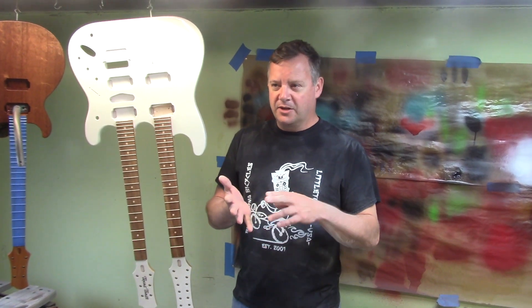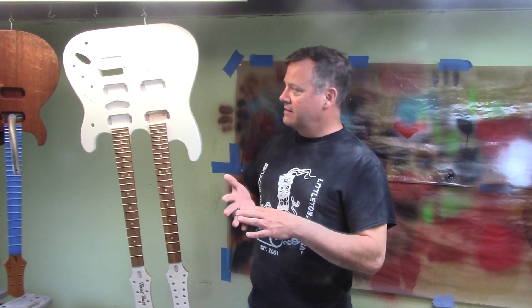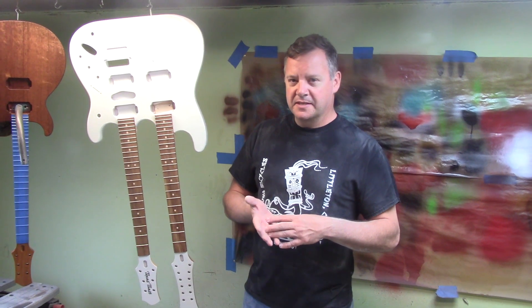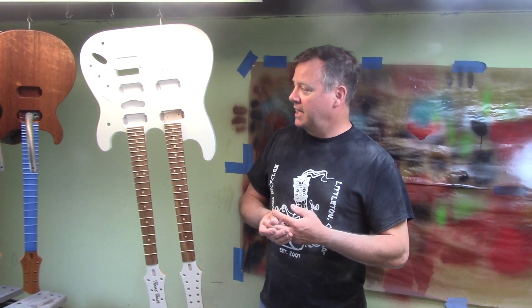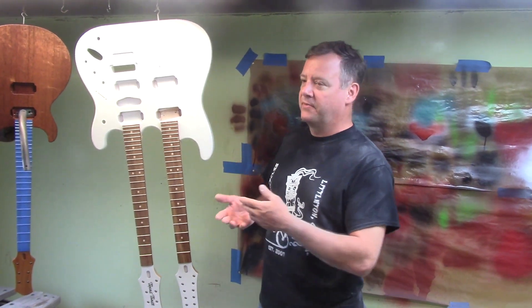If you're using metallic paint and you're sanding in between color coats, you're just screwing yourself. The only time I'll sand a color coat is if I've messed up — if it's got a big booger in it or something went wrong. We typically try to put color coat and clear coat on in the same day or at least within a 24-hour period, because that's what the paint says to do. If I've done everything right, it'll look really, really good and I won't have had to sand a whole bunch, because there's still wet sanding and buffing to do.